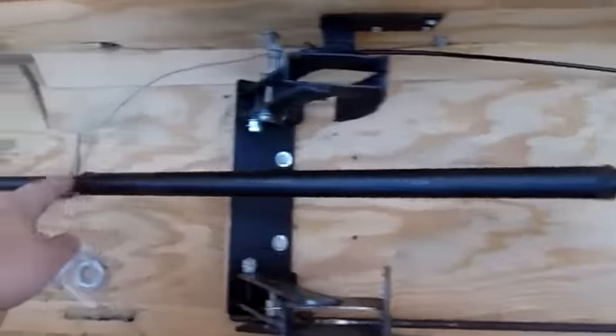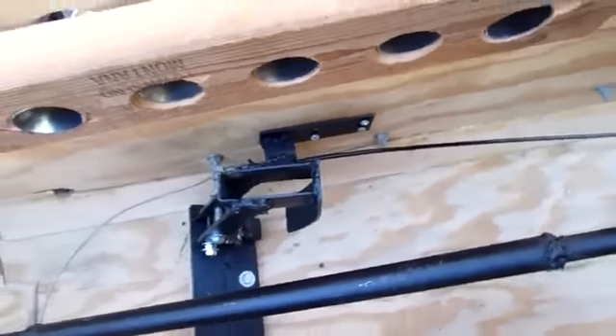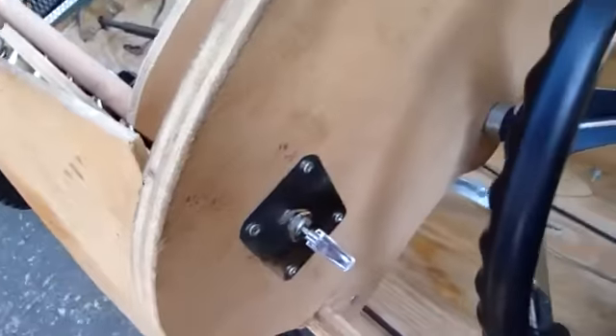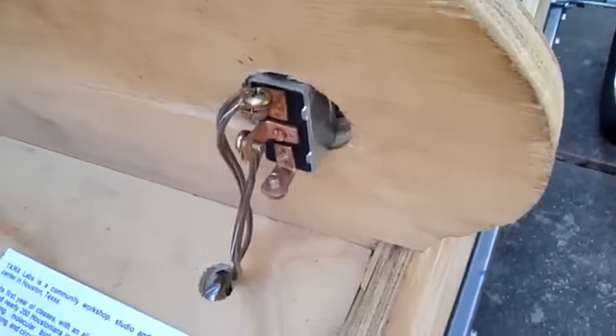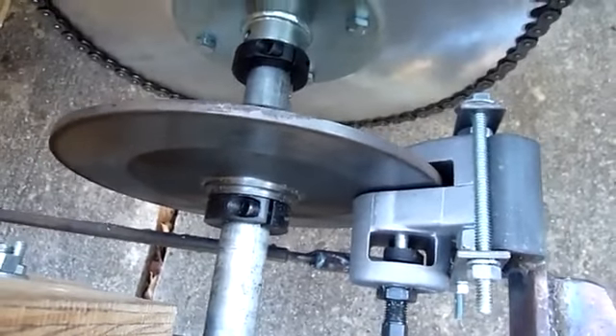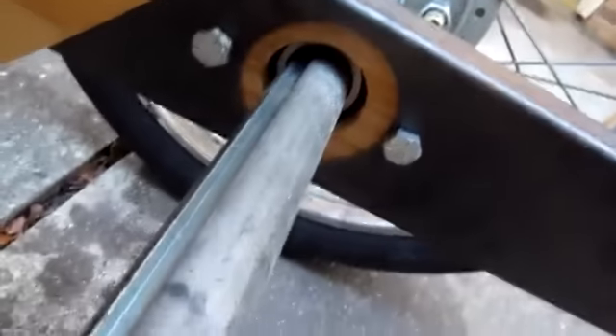Let's look inside. This is the steering column — a regular go-kart steering column that I lengthened by cutting it and putting a pipe in and welding it. Here's the brake pedal, which goes back to a brake in the rear. Here's the throttle, connected by a cable to the engine in the rear. All this stuff was fabricated. The steering wheel is just a regular go-kart steering wheel. This switch is for 12 volts — you do have to be careful that the contacts are far enough apart that a spark won't jump, so you can't use just any old switch. The brake is an Airhart disc brake, available from Northern Tool.